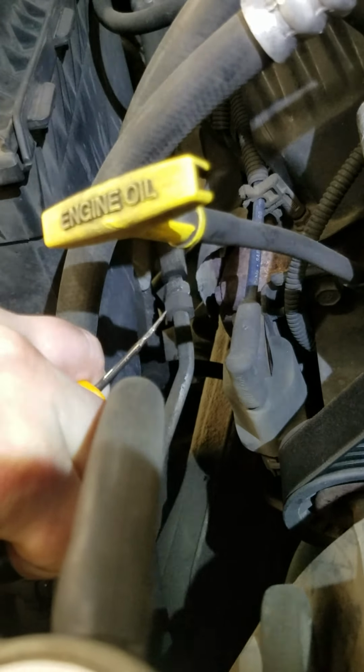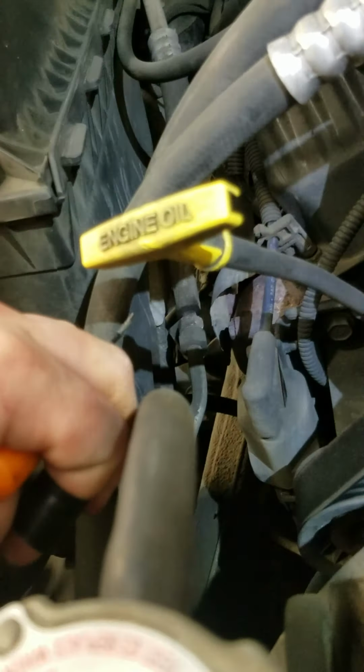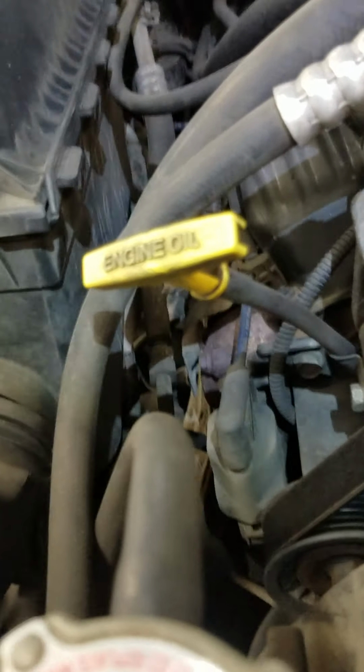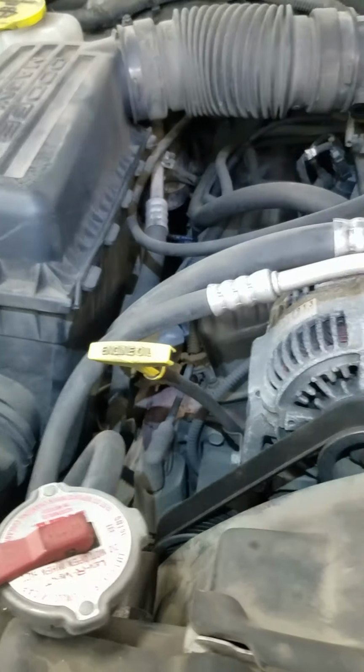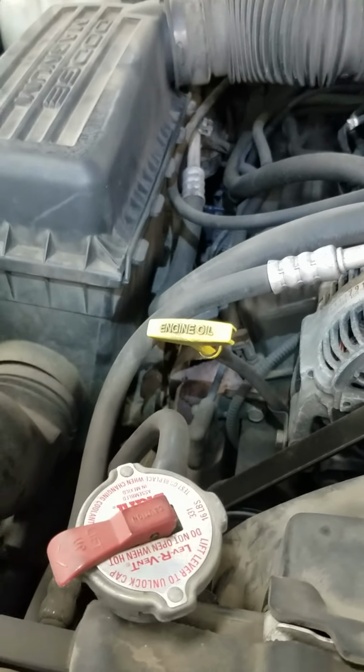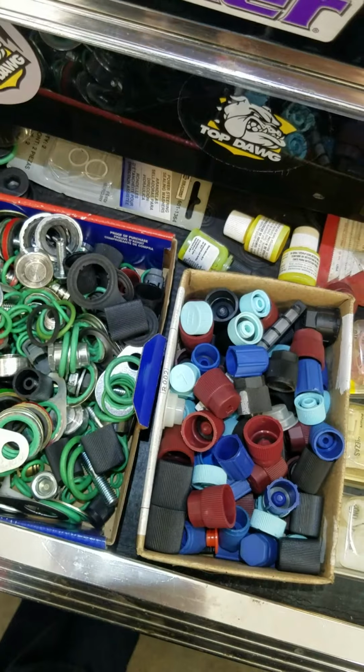So when you're looking for the expansion valve, you see, well, maybe not, but down there there's a connector. Usually they're in a straight section like that. See how that's got insulation on it? I'm betting that the expansion valve orifice tube is in there. So the right way to do this, after you flush it, is to replace that valve, because there's a little screen inside there.